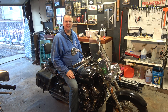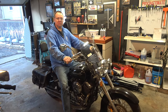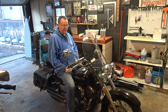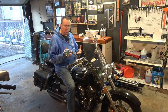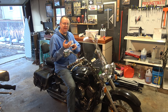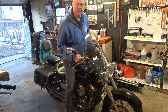Let's give this a little bit of a shot. Dell's got a little bit of an issue with the bike in that he needs a new battery, so I can't start it up and go for a ride, but I can test the brakes — I really don't need to start it for that. Brakes work. I'm not seeing anything shooting out anywhere, so I'm saying that's a success. It did not go as I was hoping — it is cold, it is below freezing, and I think that hose was just too rigid in the cold and didn't have the flexibility it would normally have. So when I was drawing it, it stretched over the bleeder nipple but allowed air to go through. But I was able to get enough fluid down through the system, and now he's got nice fresh clean brake fluid and the fluid level is good.